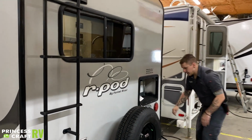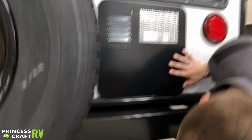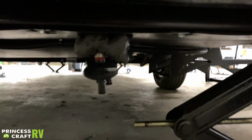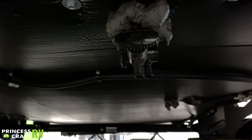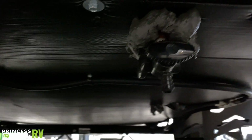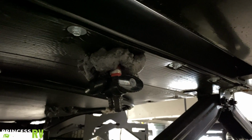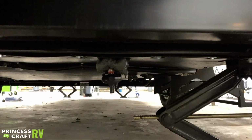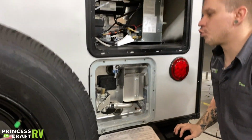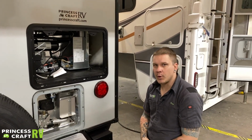If we can get low here, we're going to take a look at the low point drains. Those are the lowest point in the unit's plumbing. That's how you're going to drain everything in between water source and fixture, with those low point drains. They do have valves there, so just open up the valves. You're going to want to drain the unit of all of its water anytime it is going to be stored for more than 7 days.